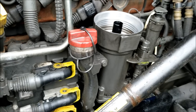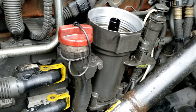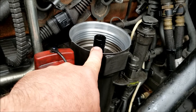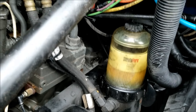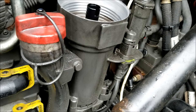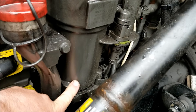What we have is a 2012 Kenworth with a PACCAR MX13 inside of it that would not start up after the fuel filters were replaced. This is the main fuel filter housing that's actually on the engine — there's your glass bowl filters. The truck would run for about five minutes and then shut down completely. What was happening is it was sucking the fuel out of this bowl and emptying it, but it was not refilling.